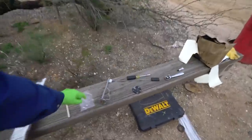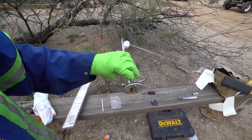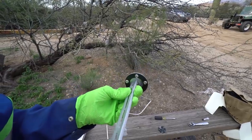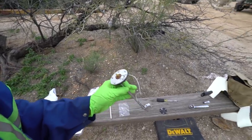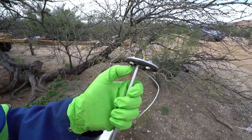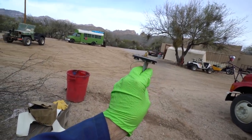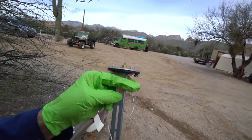I got myself in a little pickle — I got a fuel level sender, which is what tells you how full you are, but it's a little tricky to get in there because I only have about five inches of clearance. I adhered the gasket to this part because I can't see what I'm doing, and these only go in one direction. I might have to just bend this part here, or clamp it with some pliers and then screw the top part back in. I'll get to that later — you can't see anything because it's so dark in there.